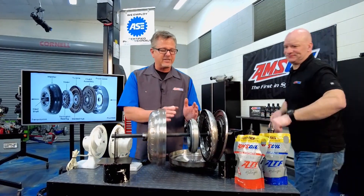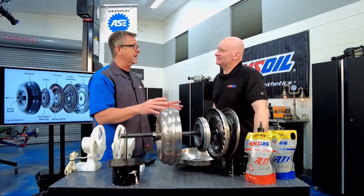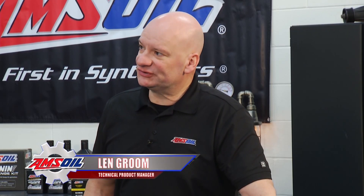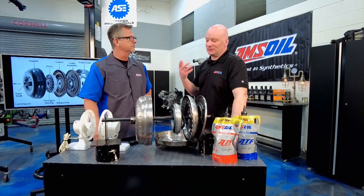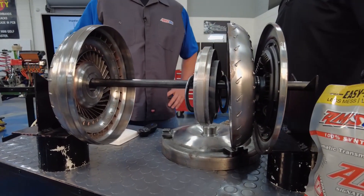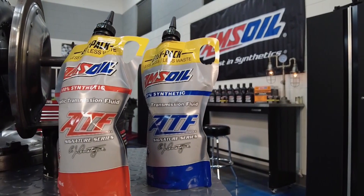That fluid has to change directions, and people don't realize — that's what's multiplying torque, period. The fluid is actually doing the job here and it gets a ton of pressure and it creates a bunch of heat. Anytime we force the fluid to change directions that quickly, the internal friction in that fluid generates heat. If you were to put a temp gauge on the converter outlet, it's flashing — you can spike up to 300 degrees when you leave a stoplight hard, and the fluid has to be able to take that heat.